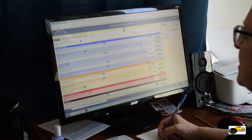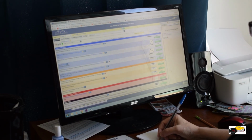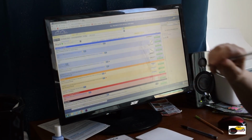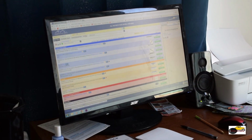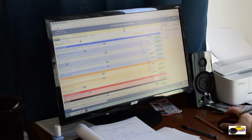The whole back is now sitting a lot lower, so I checked to see if it's airlines that are the problem or whether both airbags need to be fixed. That's gonna take a lot more to figure out. We did notice the rear shocks are toast. We need tires. The throttle body has never been rebuilt, so we're going to do that. The previous owner gave me a kit that he had already purchased for the rebuild on that. So that's something to do.